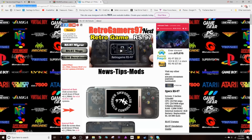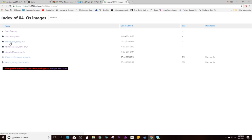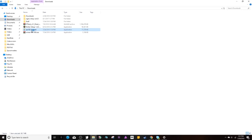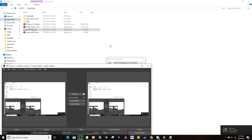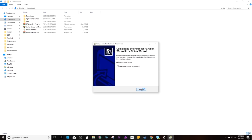Next, go to jutleys.wixsite.com — you can thank them for making this tremendous mod, not me, they did all the work. Go to the RS97 mirror and pick the correct internal version: if you have Version 1, download Version 1; Version 2 for Version 2. I told you how to check that earlier — it's on the back by the battery compartment. Download the firmware. You may have a different version available. Extract the RS97 firmware to its own folder.